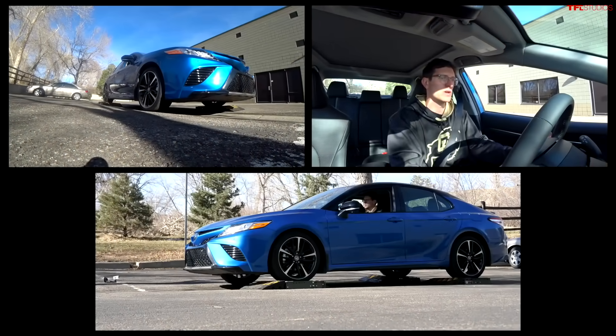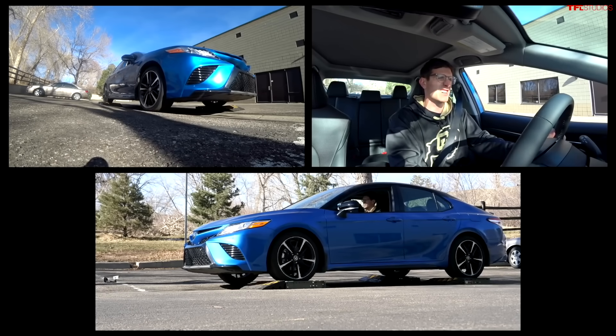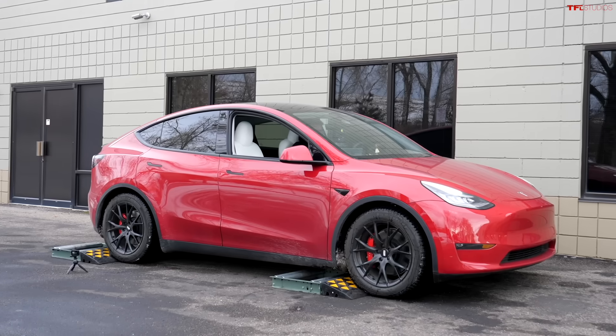In drive, traction control on, off the brake onto the throttle — it's really trying. Very good! I definitely felt a lot of power go to that right front and we were able to drive off even with that really challenging test. These electric vehicles are very cool because you have so much more control with the traction control and throttle programming. Electric motors respond instantly — you don't have to wait for revs to build, and there's no transmission lag because it's direct drive.